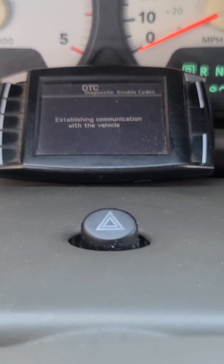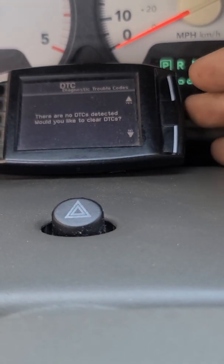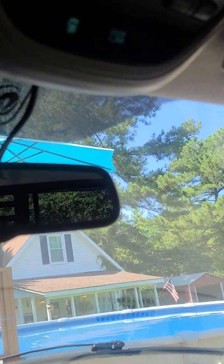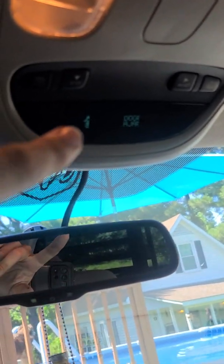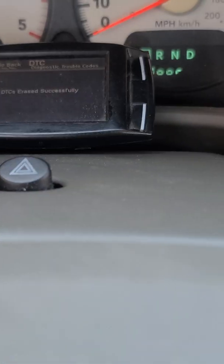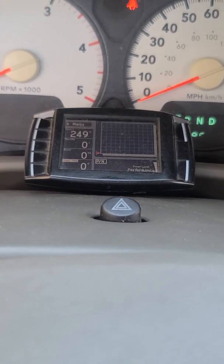Check the transmission just to make sure — no codes there. It asks if you want to go ahead and clear them anyway — yes. A lot of guys with these tuners and deletes: as soon as you turn the key on, and every 10-15-20 minutes going down the road, you'll get a dinging noise and it'll pop up 'Service Required — See Dealer.' If you clear your codes this way, it'll work. There's also another way with the brake pedal, gas pedal, and honking three times, but I don't know that one well enough. For now we are good to go — appreciate y'all.